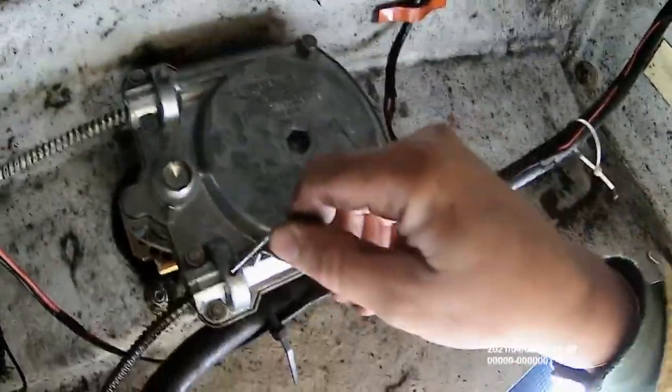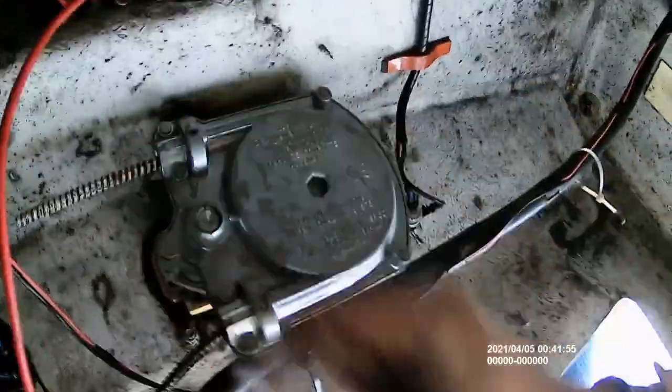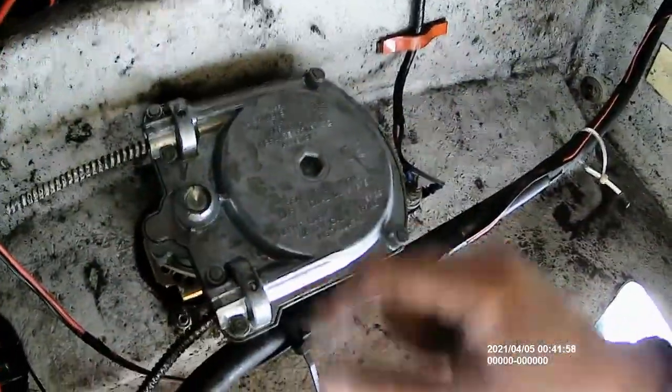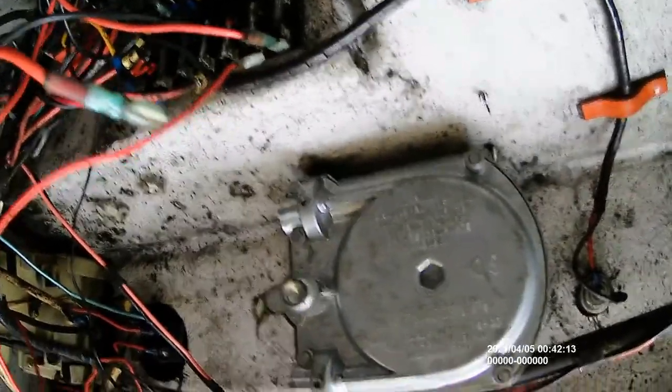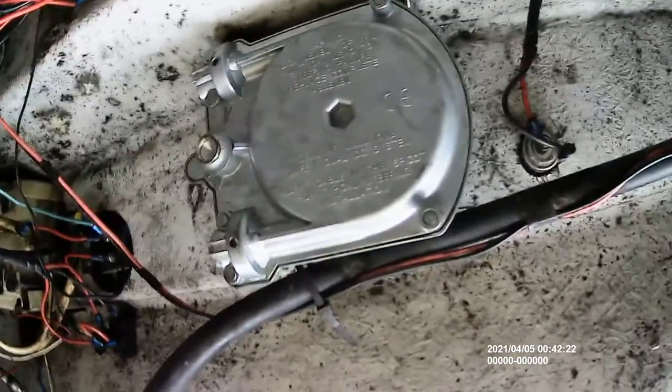So as you can see, when you push in on these little holes there, it allows you to pop out this plastic fitting for the top, exposing the kind of geared spring that allows that steering cable to stay in the helm. And you take this second one out, doing the same thing. And then once you've got that done, you can pull it out. And there it is. The wheel spins freely. The steering cable's out. Now the thing is covered with grease, which means, of course, I am covered with grease. Son of a! Anyways, that happens to me every time I do this.